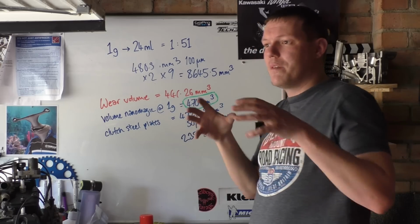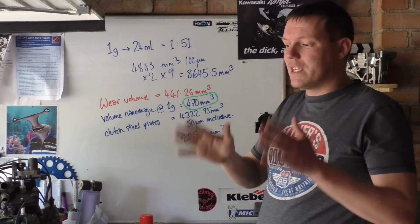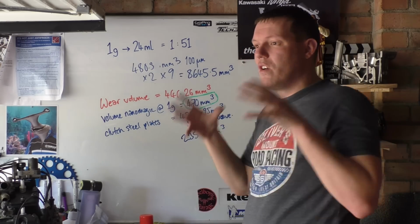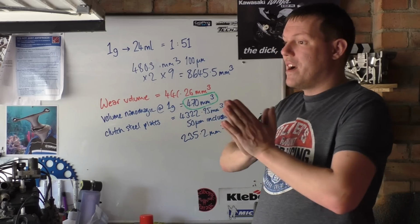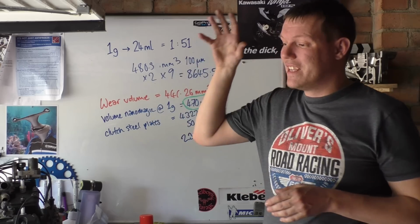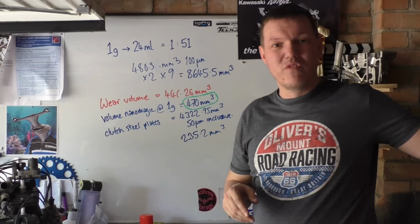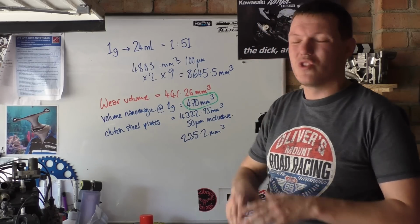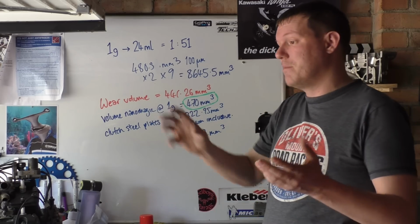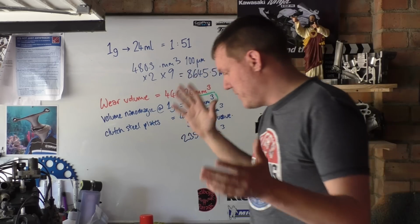See, the difference between a car and a bike is that in bikes you have wet clutches. And they say this stuff basically repairs surfaces where high pressures and oil goes. Oil goes into your wet clutch. That is high pressure, the springs are pressing against it. It's so high pressure, it can engage your engine to your transmission and to your rear wheel. Your rear tyre usually lets go before your clutch does in most cases. So there's an awful lot of pressure there. You can measure the pressure because you measure the springs. It's bullshit. I'm sorry, but it's just rubbish.